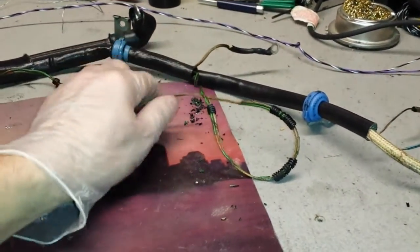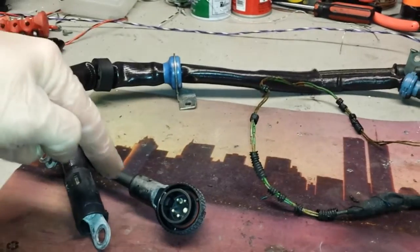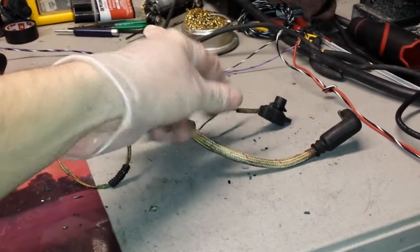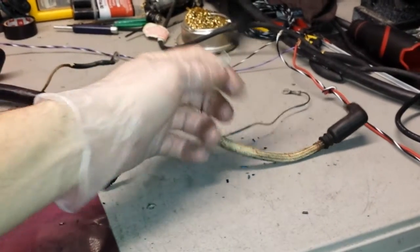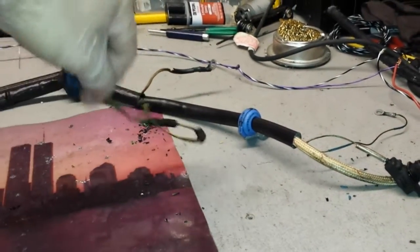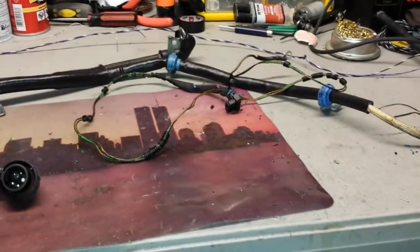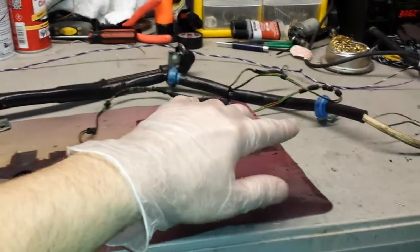It all seems not super important, but it is very important. The shorting cable can short anywhere along the full length of the harness with any of these wires. This cable always receives a positive signal to energize the alternator, and when it shorts with this one it goes straight to your cluster and can burn out your cluster. The same can happen here — these wires can short, so when a signal goes to activate the starter it would short with the oil level sensor and short out that circuit. Not good at all.